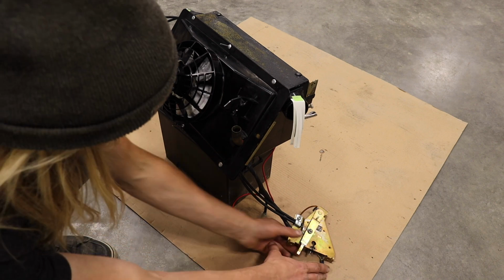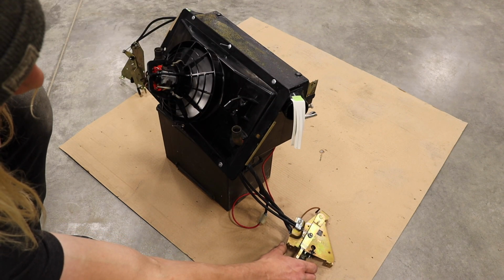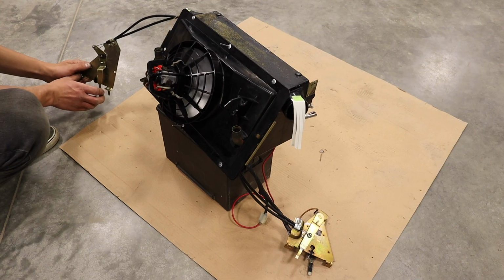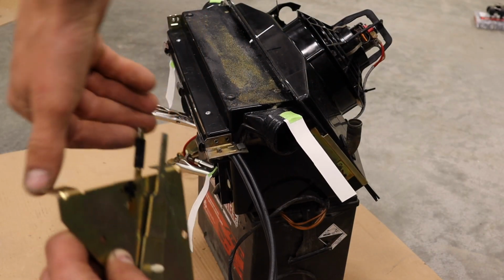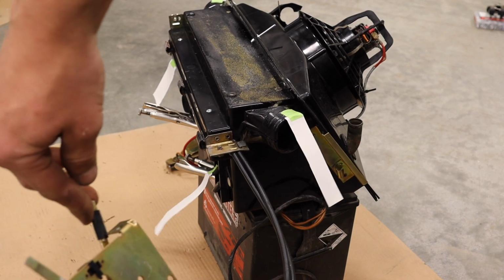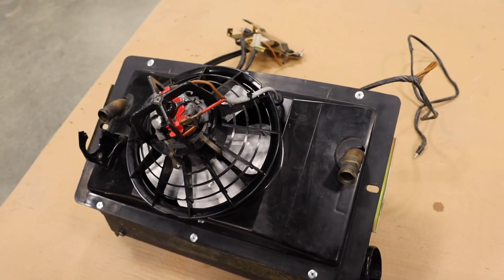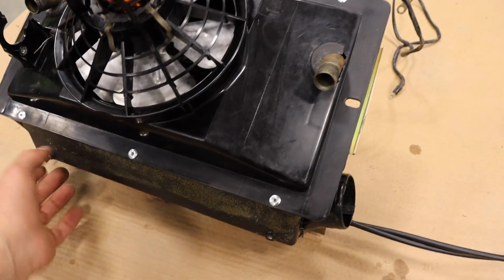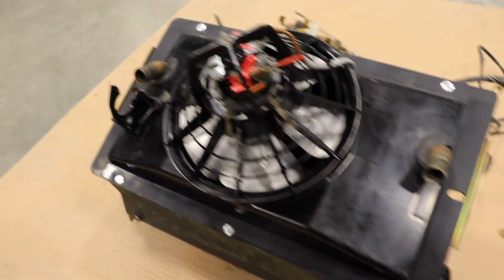These guys should go, but we're gonna test the fan. So even though they're fully closed, there shouldn't be any air coming out of that. Nice. Speeds work. Full speed. See what this thing does. Motor works, everything seems to be functioning nice. So I pulled the rivets tight. It is basically ready to go in the car, except I have to do a little bit of foam here, and then glue a piece of foam here as well. And then of course, my heater valve. Then it'll be ready to go in the car.